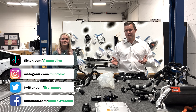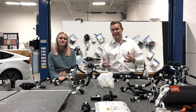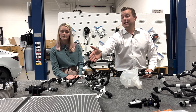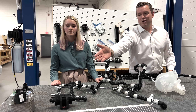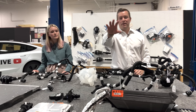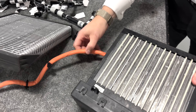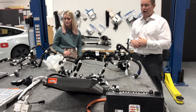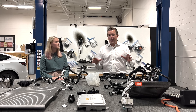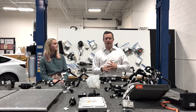Let's get right into it. My initial assessment of the thermal system for the Rivian R1T is that it's executed well with off-the-shelf components. There's no world-beating octovalve or high level of integration. We have off-the-shelf pumps, off-the-shelf chillers, a standard condenser for the refrigerant, a standard heat exchanger for the ethylene glycol, two off-the-shelf valves (a three-way and a two-way), a standard evaporator for cooling the cabin, and a PTC heater — a positive temperature coefficient — with high voltage input. The material choice for the lines is primarily PA12, nylon 12, with quick connects on most components.